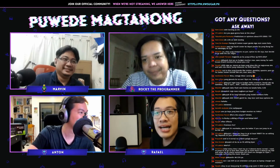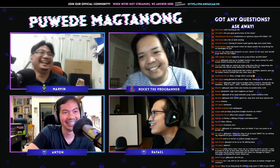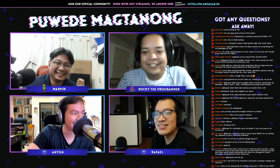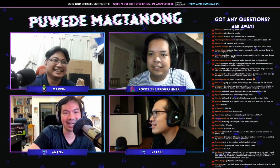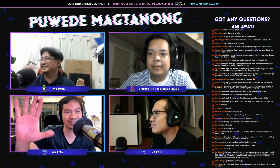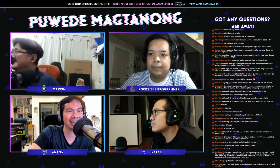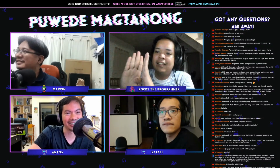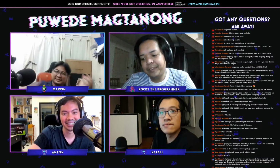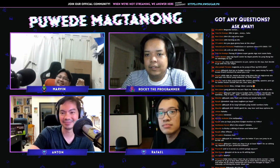To answer Alan Joseph's question, is the airflow of the H510 Elite good? No. Okay, there we go. It looks super pretty, but the airflow isn't good. What makes it pretty is also what makes the airflow bad: the glass front, which allows you to see those very stunning 140 RGB fans. The air can't enter at all. There's hardly any space to enter, and there are super minimal vents on the sides, with the panels flush at the corners. So it looks really good, but airflow is not great.